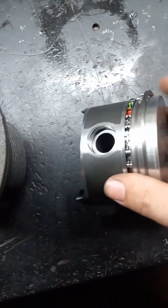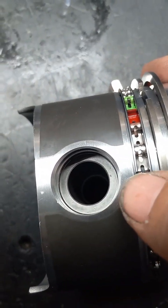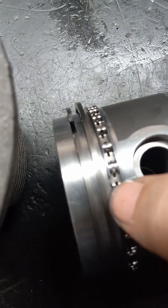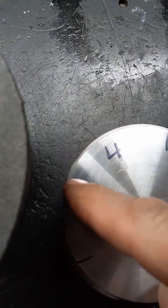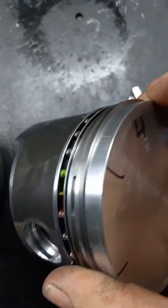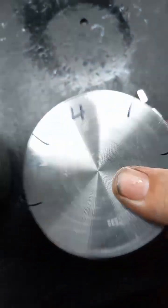Okay, so your bottom ring — you can see it, I'll point to it with my thumb. See the gap? Your next one up on there is going to be on the other side. Right there — I'm pointing to it with my thumb, with my shitty camera. Then your next ring up is going to be lined up here, and then the top ring there. So if you look there, you'll see the gap, that's the next ring, and then the top ring.